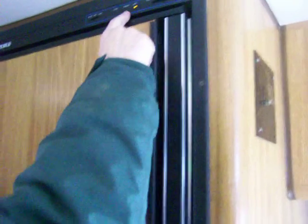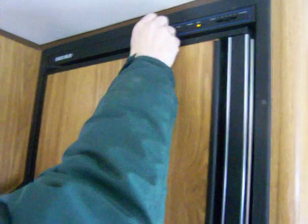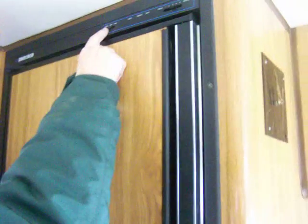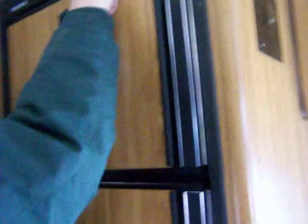These switches — right now it's on LP, so this is running off gas. Here's the switch; we want to put it on off, in the middle. It was on auto, so when it wasn't plugged in, it automatically turned itself on to gas. So when you're on the road it runs off LP, and when you're at a campsite it runs off electricity. That's a nice feature.